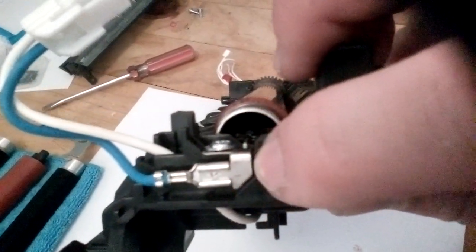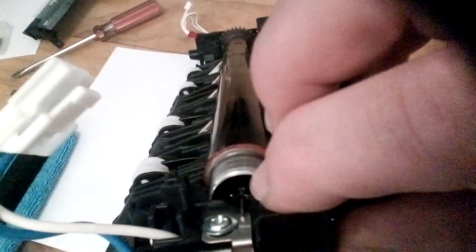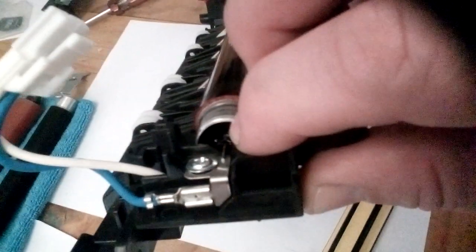So we go over here, we undo this cover, take that screw out, this cover comes off like so, and you can see in here it's screwed, and this is how it's clipped on to the end of the lamp, and you see the lamp goes through the middle. Got to be really careful not to put too much pressure because you can actually break the lamp and crack the end of it and let air into the lamp and blow it, of course.